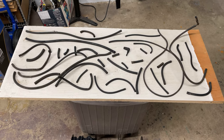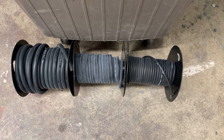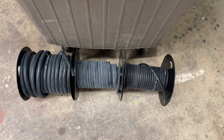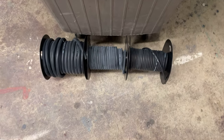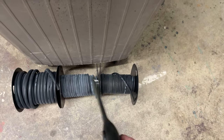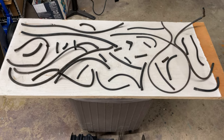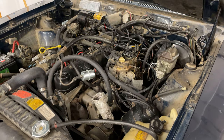That diagram is only slightly helpful because it doesn't include the cruise control lines and stuff like that. So what I wound up doing is buying some spools of vacuum hose — I believe 7/64ths, 5/32nds, and 7/32nds. I will verify the sizes and put them in the description. I bought three spools of hose off Amazon because I had no idea how much I'd go through. Realistically the bigger hose I probably didn't need a full spool of, but I've always got different projects and for the cost it's not that bad.